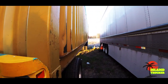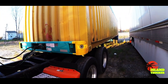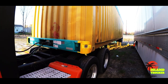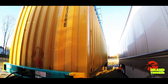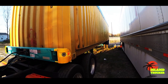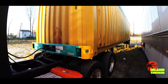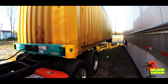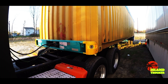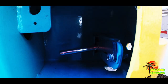There are people out there that will unlock your pins. You're going down the road, you take a turn, and next thing you know the container is laying on the ground. Sometimes you pick up a container at the port and you're in such a rush that you forget to lock your pins. There have been multiple occasions where containers fall off the chassis because someone forgot to lock it. That's how you secure the container to the chassis.